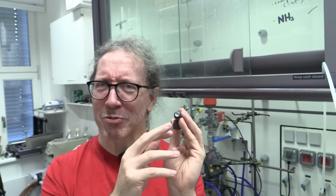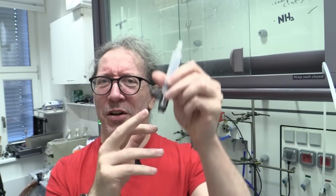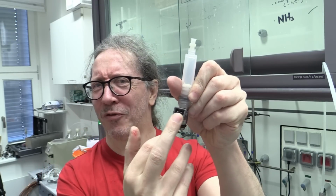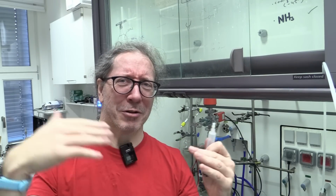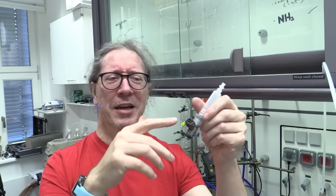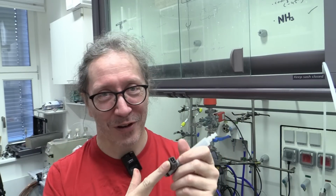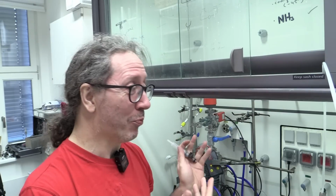You'll see there are 3 little holes in there, and the rest of it is a solenoid. It's just a regular solenoid. You put voltage over these things, you can open and close the valve fairly quickly, which is what it's doing with your engine. So every time you want to inject fuel in, you open the valve up for milliseconds, a very short period of time. The testing kit that I've got turns out is more for just checking that the flows are good. So it puts through a lot more fuel than you would regularly put through in your engine.